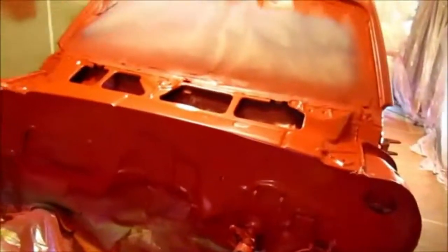And the rockers. Let's see if we can get a picture of the rockers. Here's the rockers. Hinge area with the detent came out pretty sweet. Finally see what the color looks like, and it is awesome. So now I'm gonna do the clear coat. I'm gonna do 2 coats of clear. And this base coat has already dried. It's been about 45 minutes to an hour already. I really like the way it came out. So, next time, it'll be in clear.